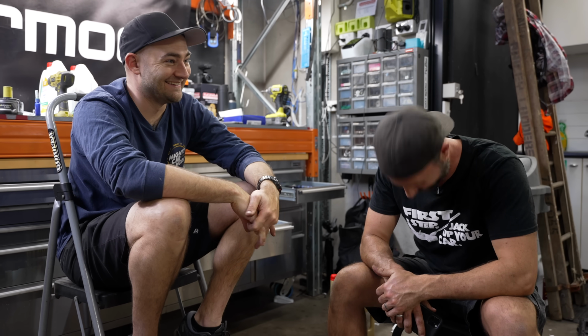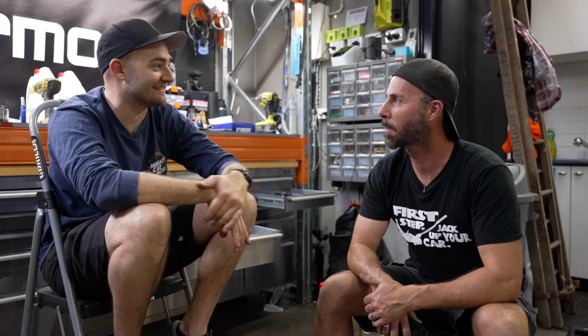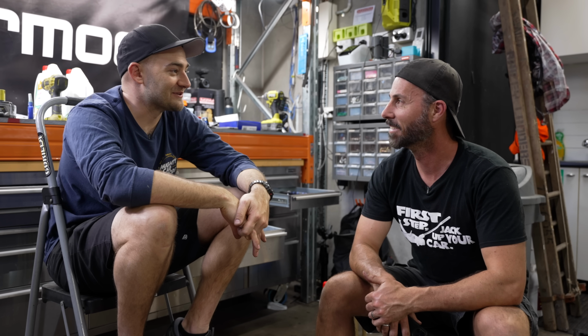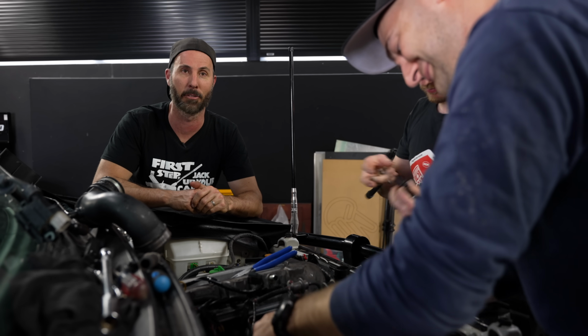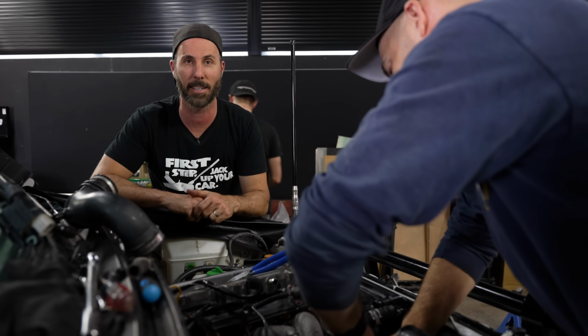No, it's fine. It just needs a bit of oil down the valves. That'll fix it. That'll bring the comp back up from 0 to 180. Especially in cylinder 2 where it was 20 psi. That's only going to come up to 160. Easy. Bit more oil. Let's send them their photo. Should we send them a YouTube link of this video? So everything we did, we're going to start reversing that and start pulling stuff out. Sucks so bad, pulling it out again.